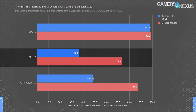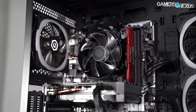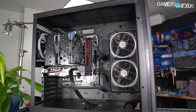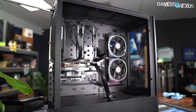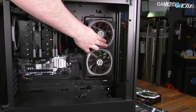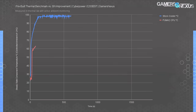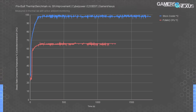With a CPU and GPU workload, our GPU temperature maxes out at 73 degrees Celsius, or 87 on the hotspot — actually not bad at all — so it's just the CPU that needs a better solution. It doesn't help that the tiny Cooler Master solution maxes out at 1700 RPM while running only a 100mm fan on an 80mm heatsink. We mounted a Scythe Fuma 2 to the motherboard just for perspective, and then we flipped the two side exhaust fans around as intake. Our goal was to establish that you can actually make this computer into a really good, competently performing system with about an hour of effort. It's not ideal, but it's workable — unlike Dell's. We reviewed this cooler separately and found it to be good value at $60. You could still get better results with a $30 solution than the stock one. We're now below 70 degrees Celsius and within roughly the same area for noise.